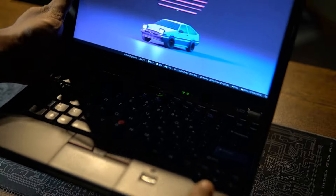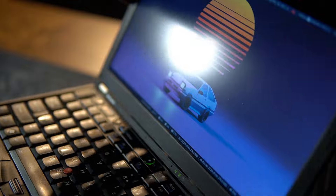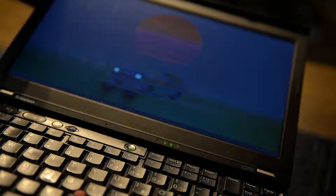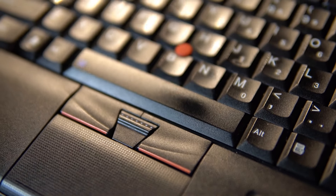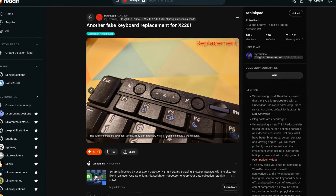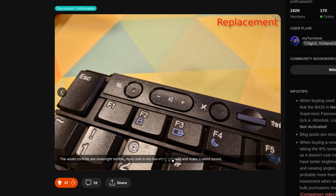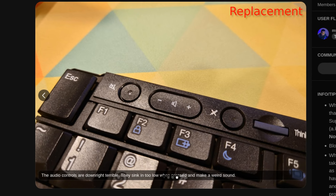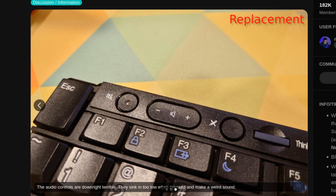The 768p TN HD panel on this machine has terrible viewing angles, and I had a failed attempt at replacing it with an IPS screen that started shimmering as soon as I connected it — I haven't attempted another display upgrade since. Also, the spacebar key on the keyboard was pretty worn, and given how difficult it is to get a good replacement keyboard for one of these, that was a failed attempt as well. You can either get a new keyboard that's nowhere near the original, or get a used original for around the same or often higher price but with some wear.